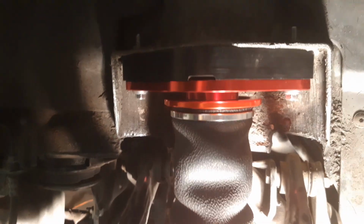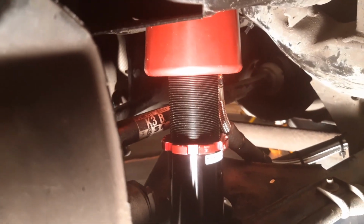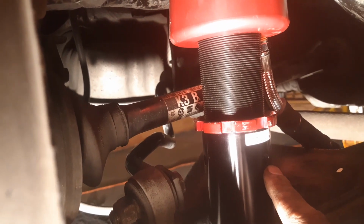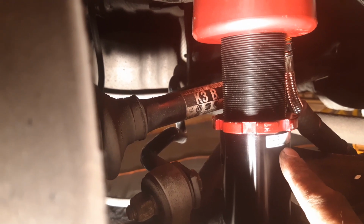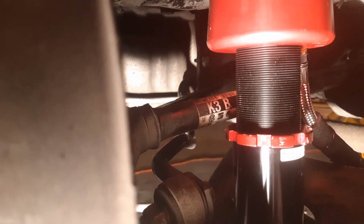Looks beautiful, feels beautiful. I'm going to show you the reason I needed to reach out to Dan in the first place for these. This vision window here. You must be able to see threading through that window, otherwise you've exceeded the limit, and then your surface area between the two is so minimal, it's just going to be a matter of time before things snap off.